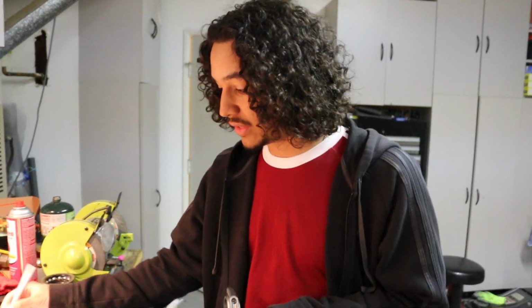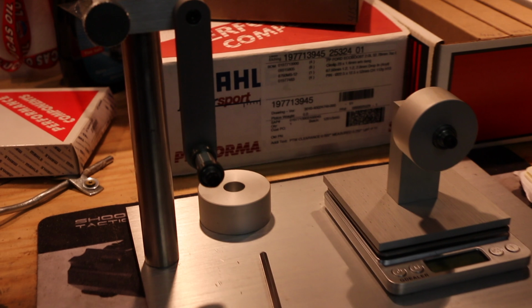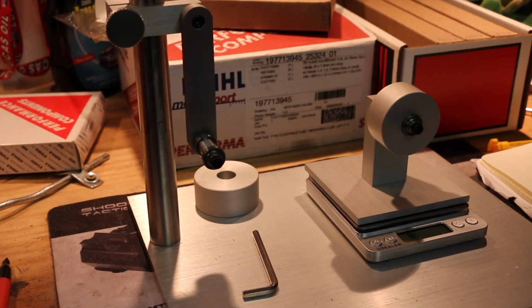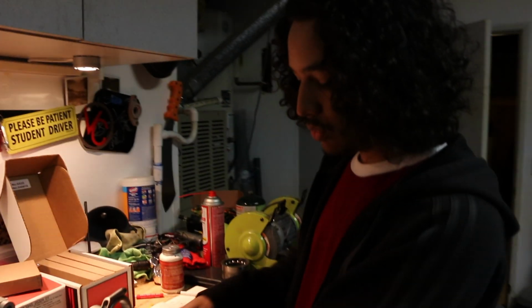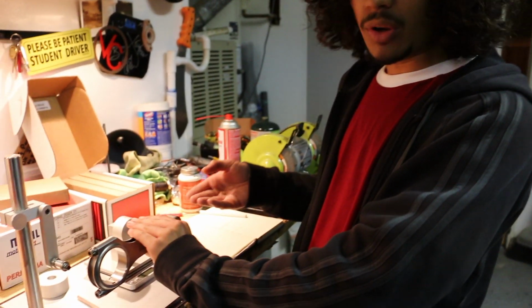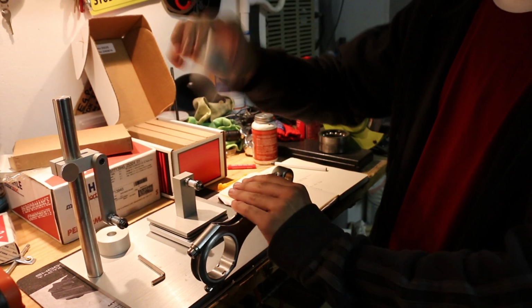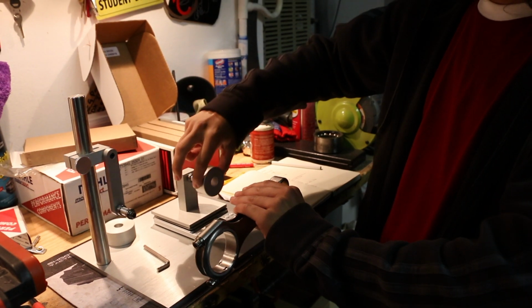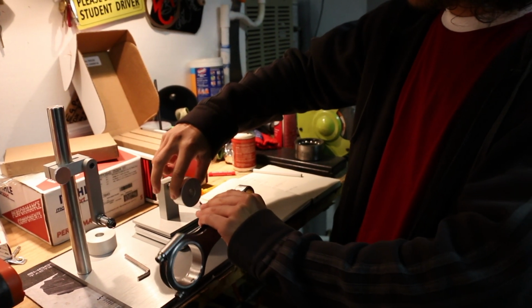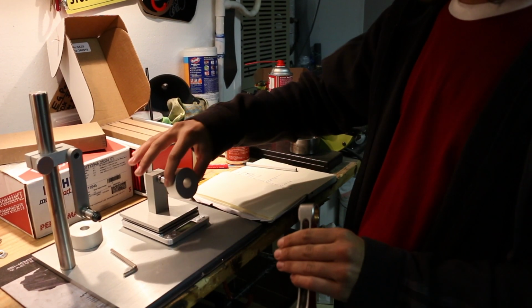So this is just big ends. These measurements are just big end weight. When you start measuring the pin ends, that's when you most likely have to change your setup with this whole kit here. So instead of measuring the big end weight, which is where the scale is right here, you think vice versa: flip it over, take this, I don't even know what to call this, I guess a spacer, put it on the pendulum, and then flip the rod and measure it this way. And that will give you your pin end weight.